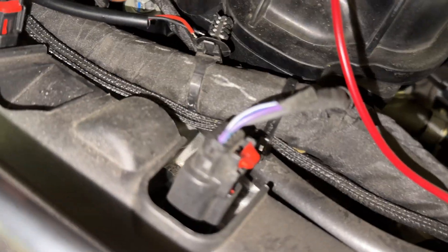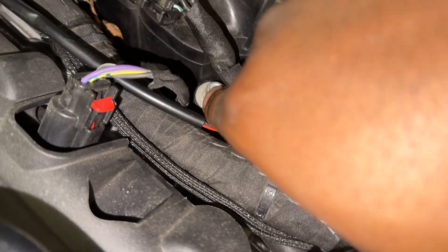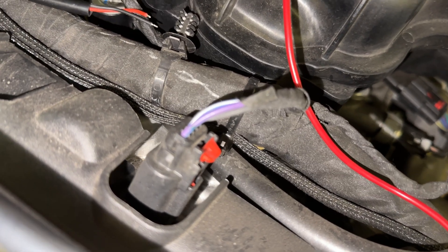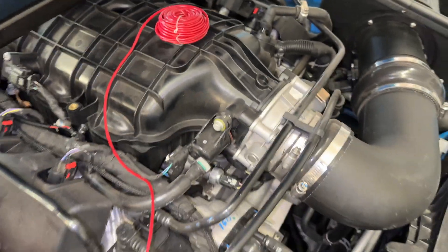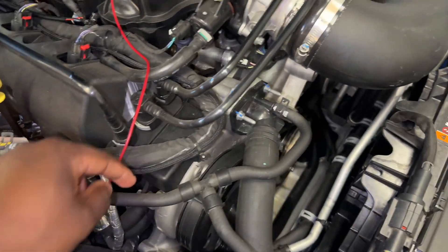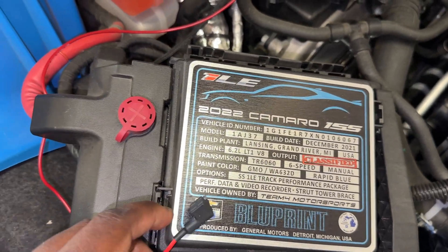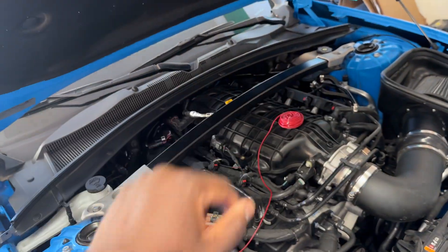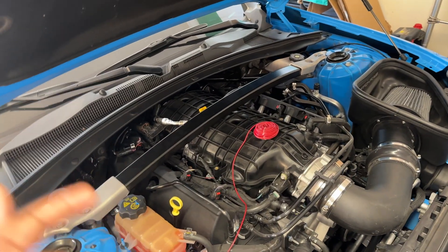For the ground, I'm going to take this black wire and ground it to the intake manifold bolt. Then I'm going to cut this red wire to give me enough length to route it similar to my E85 line, so it just sits underneath there and the gauge should be working. That's what I want to clarify during my install of the AEM air-to-fuel ratio wideband.